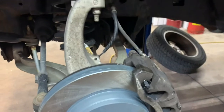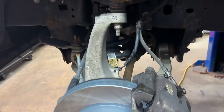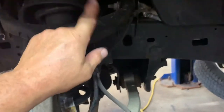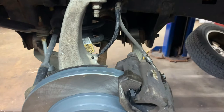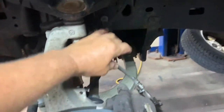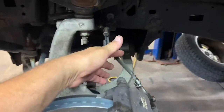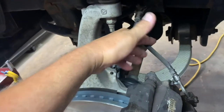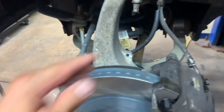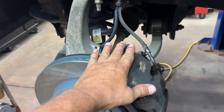When bleeding brakes — say you replace the left front caliper — do not let the system run dry while replacing the caliper, because the ABS system makes it even longer to fix. What you want to do is put a line restrictor that squeezes the line — something like needle-nose vice grips, but use the proper pinchers, not vice grips, because those can pinch too tight and cause the line to crack or split. Use a small clamp or C-clamp, just restricted enough so it doesn't drain your whole brake fluid system.